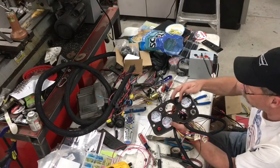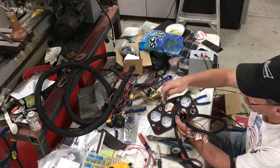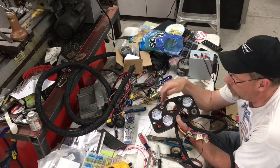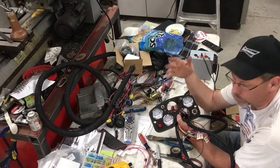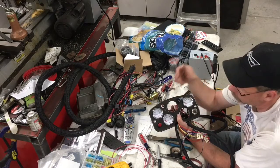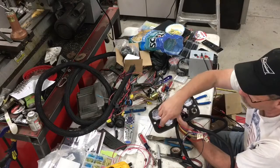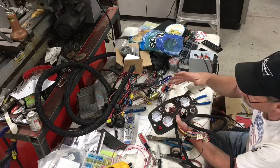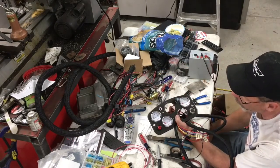I've got the headlights set up so that when the switch is pulled, the lights on the gauges come on. Anytime the power is on, it reminds me that the main power is on, because there's a master on-off switch for the power. I've added a horn switch and a headlight switch, and those will actually control just relays that will then power those different items.